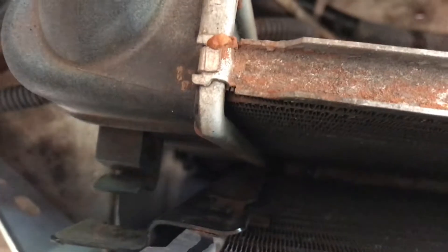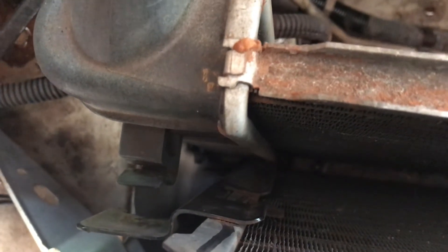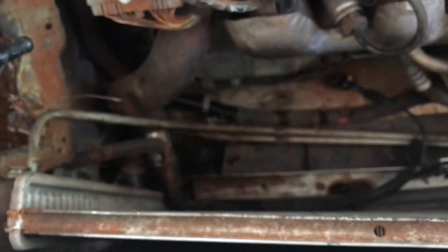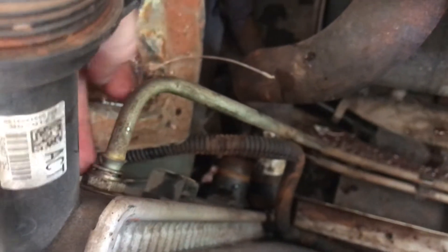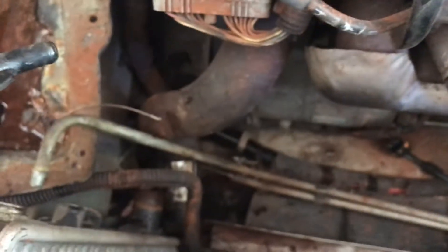That's what it looks like, and then way down on the very bottom there's another clip down there that does the same thing. So basically you've got to pull both of them up and tap down on the radiator on both sides to get the condenser higher than the radiator to get them to unclip. These are your transmission cooler lines — they're actually pretty simple. There's just a little clip that goes around the outside; you pop it out and pull them right out. There's two of them, an upper and a lower. And of course you've got to take your upper and lower radiator hoses out.